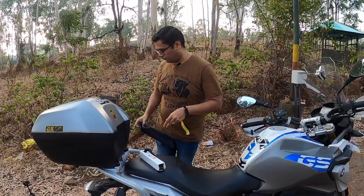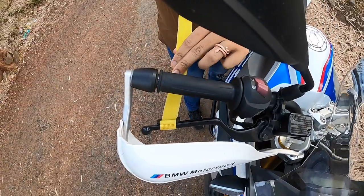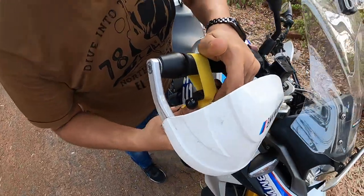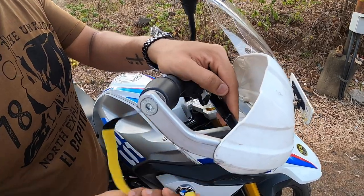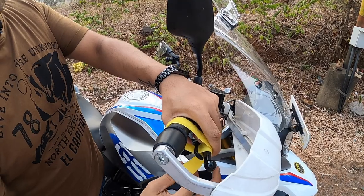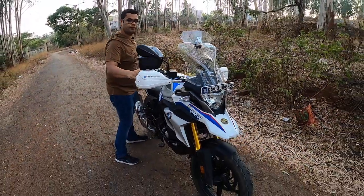Let's try to put that in as well. Keep this away so it doesn't fly away. First, make sure your bike is in neutral. Just make sure you tie your front brake fully applied. The only thing you have to do is make sure you're circling the strap in the right way — doing it wrong won't work, so you can't literally just strap it up. Strap it up with the brake fully tight, then twist this across and make sure the strap holds the brake. Right now, the bike shouldn't move — that's the whole intention of it.